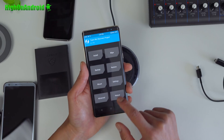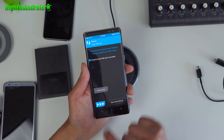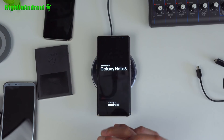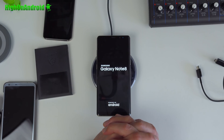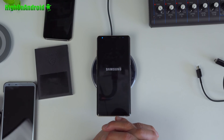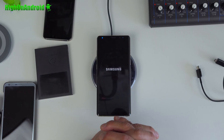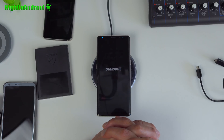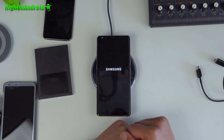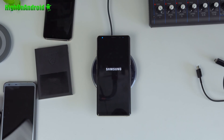Also, when there's a new version of Magisk, you'll be able to simply reboot into TWRP and reflash the new one. Reboot system and choose Do Not Install. Leave your phone for about five minutes and you should have a fully rooted Galaxy Note 8 on the latest Oreo. This root method may work on future Android P — if it does, I will update my written tutorial on my site.